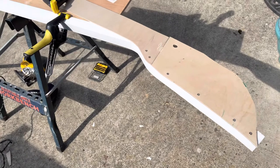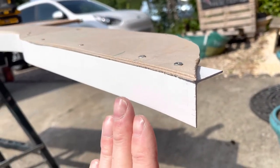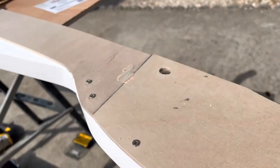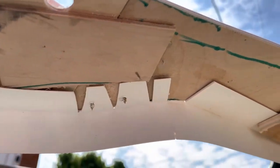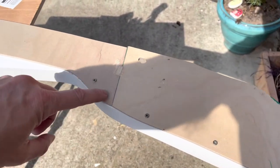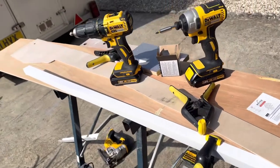Just scribed out the back of the B pillars and fitted some L-shaped profile plastic so that when we wrap the carpet on, it's going to come around the edge of the existing B pillar. I've profiled along it — where you've got corners, just cut little nicks into the back side so you can bend the front and profile it all the way along. Then put little 12mm screws through just to hold it, contact adhesive, and carpet trim it. Once it's carpeted, it should look all right.